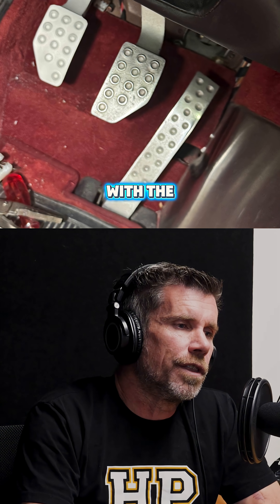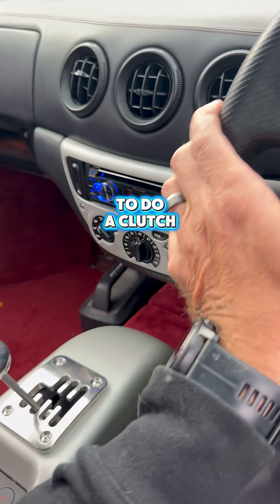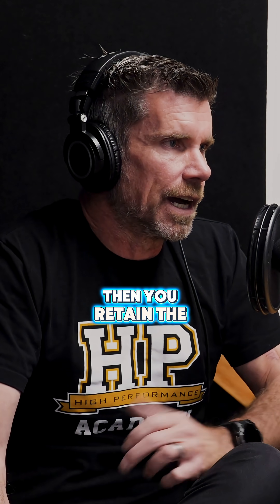The tricky part is that with the F1 shift, everything runs on hydraulic fluid — essentially ATF — and the release bearing inside the bell housing runs on that as well. Generally, if you're going to do a clutch at the same time, you order a new release bearing with seals set up for normal brake fluid. But if you're not doing that, which we didn't, then you retain the ATF for the clutch system — that's pretty much how that works.